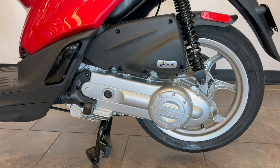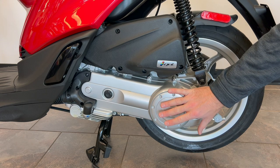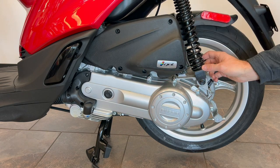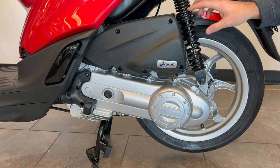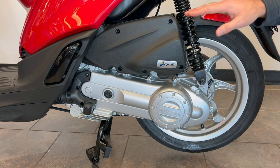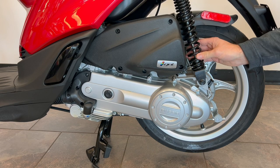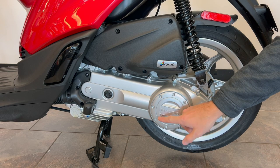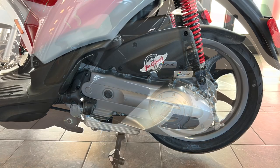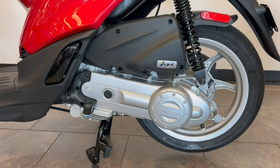On the rear of the scooter, scooters tend to be a little heavier for their size than motorcycles, but all that weight is down low. The large area under the seat gives you that huge storage space. You've got a single variable rate spring — tight coils on one end and a wider coil on the other — designed to handle both large and small bumps. The whole thing is a swing arm. A little trick for identifying 50cc vs 150cc: the 50cc will say Piaggio and have a certain look here, while the 150cc looks different — I'll show a picture on screen.